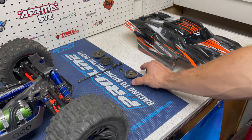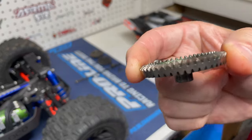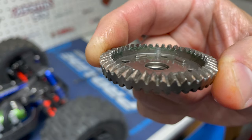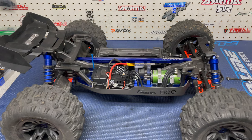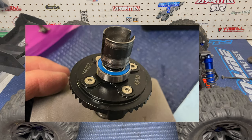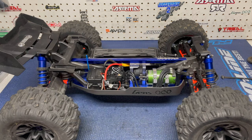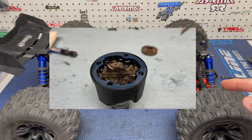On the last outing, I destroyed the ring gear from the rear diff. You can see the teeth are starting to chip on the edges. I eventually replaced those diffs — those ring and pinion gears — with the Traxxas machined steel gears. I also changed the diff oil: I've got 40wt now in the rear and 50wt in the front.